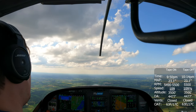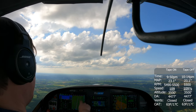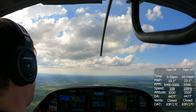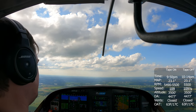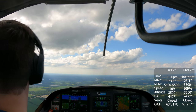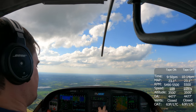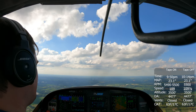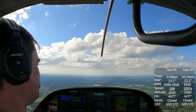So I think we're going to call it a wrap at this point. We're looking at a speed difference of just one half of a knot. So if you're going to do something about your wingtip handholds, you're doing it for purely an aesthetic reason — it's not even really a measurable difference on the airspeed indicator. The biggest problem I encountered during testing was being able to keep the engine RPM at precisely 5,500. Sometimes it would vary by about 10 RPM up or down, and you have to hold it long enough for the airspeed to stabilize. If you're talking about a stabilization of just one knot, that might take some time. In the end, I think we can put this one to bed.